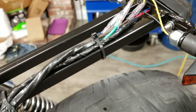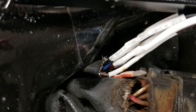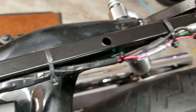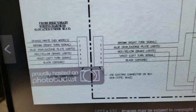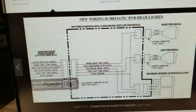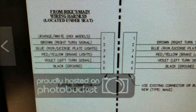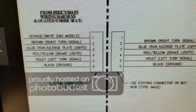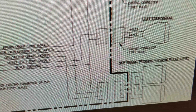I've got it all wired. Basically there was a six-lead plug, and of course someone had put a different taillight on it with weird blinkers, so I had to splice every wire. I was lucky to find on the internet that plug — they were doing exactly what I was doing, which is taking that six-wire plug and bringing it down to five, which is all there is in the back of the Harley: turn signals and brake light.